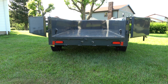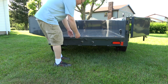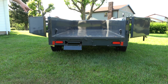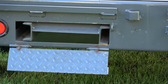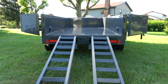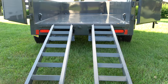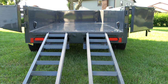The next feature is the two built-in ramps. You can haul equipment up here — keep in mind this is only a five-foot-wide bed, so you're not going to be hauling anything with a sizable mower deck, but you certainly do have that capability. Notice the retention system for the ramps. On a lot of models you don't have that kind of retention system — instead you have a simple pin that people complain doesn't line up. I should also mention these ramps are definitely overbuilt; it's very heavy gauge steel, so if you're hauling equipment you're not going to have a problem as long as it fits within the bed and weight capacities.